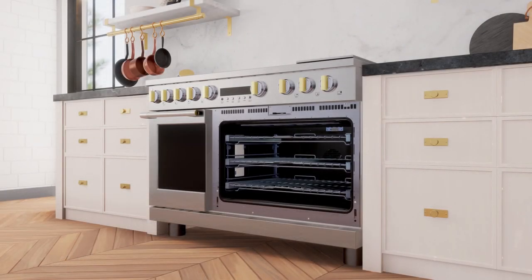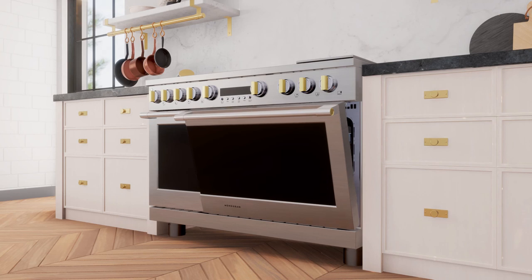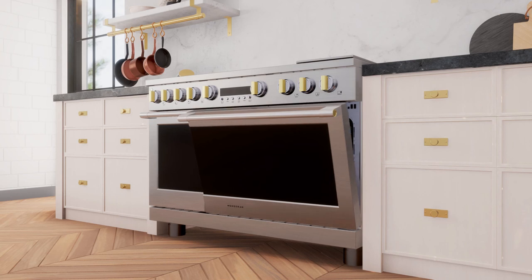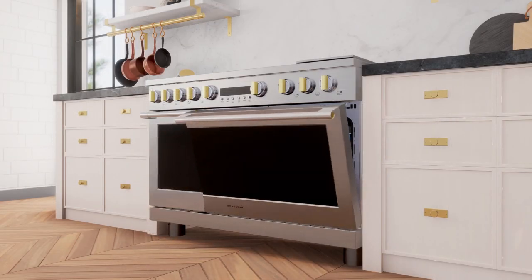You can skip this step if the oven doors are already in place. To replace the oven doors, do not lift the door by the handle. Firmly grasp the door at the top sides, then approach the range with the door angled in a vertical position. Insert the hinges into the respective slots, then push the door firmly while opening. After fully inserting onto the hinge, open the door completely and push the hinge locks back towards the front frame, then close the oven door.